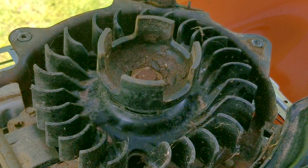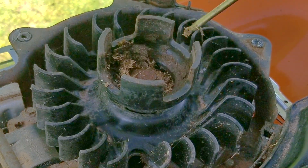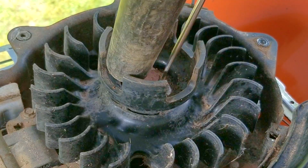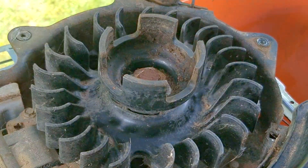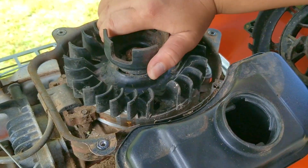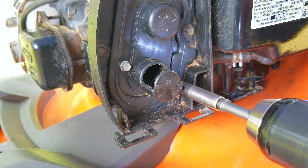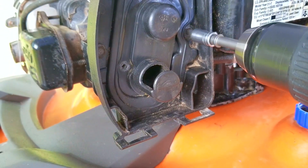Even without a working recoil, we can still test to see if the engine still works — to do that, I intend on spinning the engine over using the nut holding the flywheel. There is a lot of buildup around the nut, so for the socket to fit, we need to clean this area first. Actually, I haven't tried to rotate the engine just yet, just to make sure it's not stuck, and fortunately it isn't. The next thing I want to do is inspect the jet on the carb, and if needed, clear any clogs. Normally I would remove the carb to do this, but this time I'm going to do it the easy way.